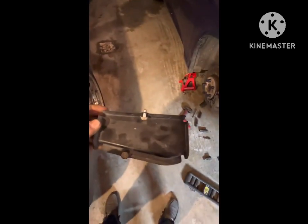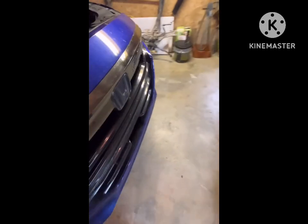I got 2 tranny bolts out. One of them, the exhaust, like you have to monkey around with it to get it out, but this is the frontmost lower one. This is a dust cover, they call it. It's got 2 10mm bolts at the bottom of the transmission. It goes right here. That's the dust shield. But like I said, I got this bolt out, but since the PRL downpipe's a little bit bigger, it doesn't just slide out like this one.